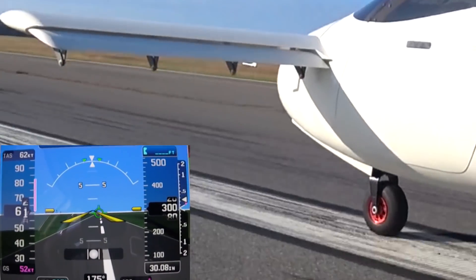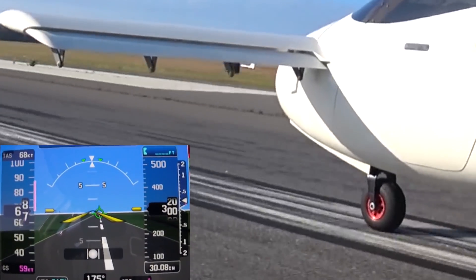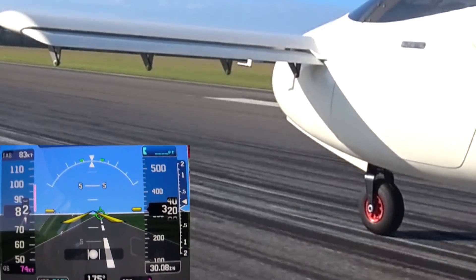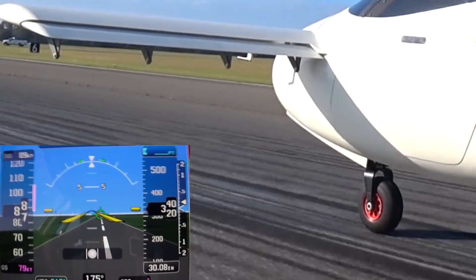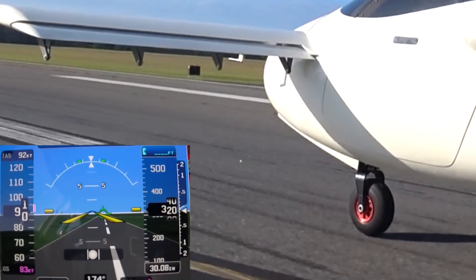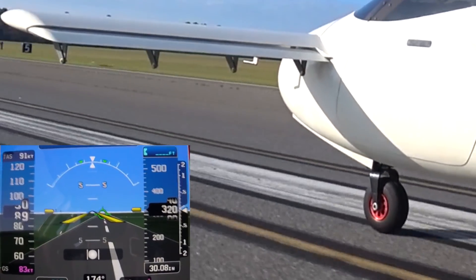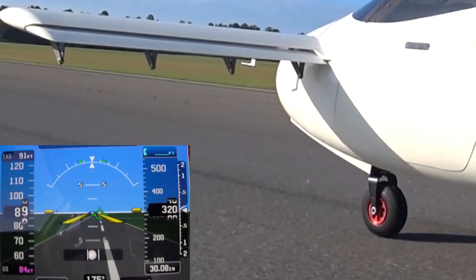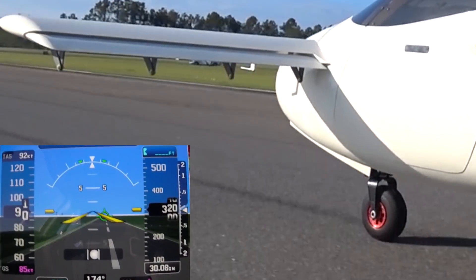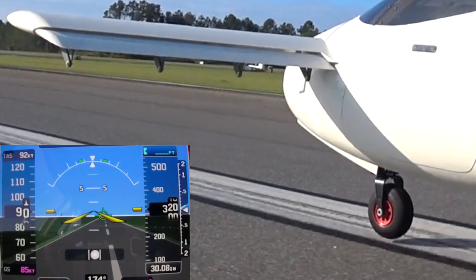With the G3X display you can see what was going on. I brought it up to about 85 knots — 90 knots indicated if you look at the ground speed in the bottom left corner. I was just adding a little more elevator to see if I could get the nose to feel like it was coming off, and right about there it did come off. You can see the elevator is more deflected now than before, which is understandable because there's more weight in the nose.